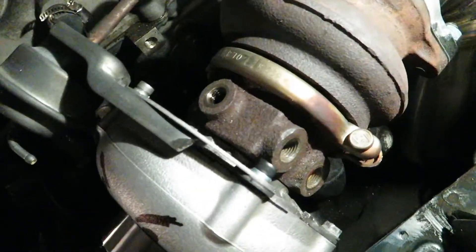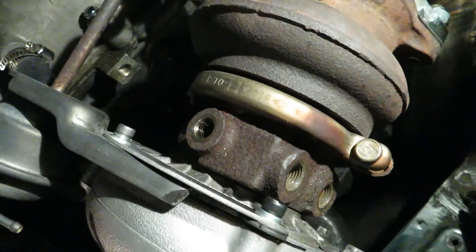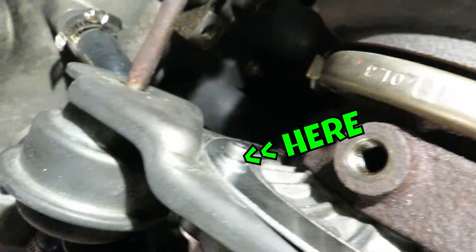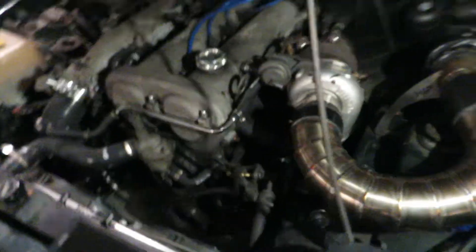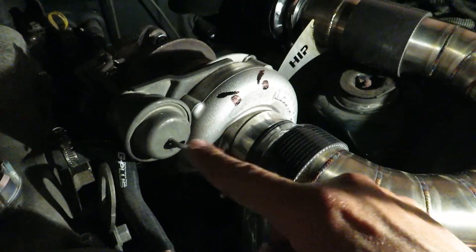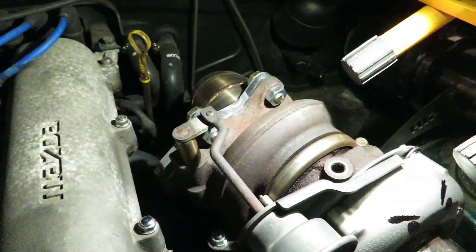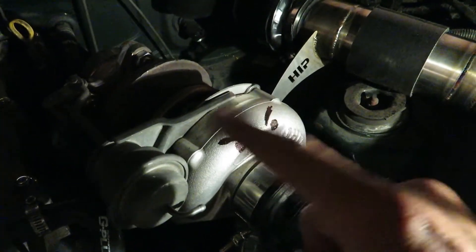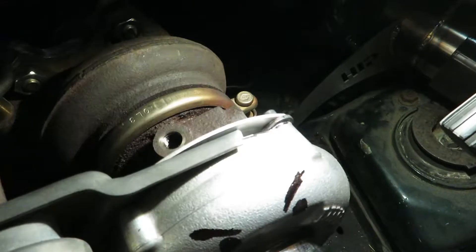Let's draw our attention to the bracket at the back — the wastegate. You can see that I chopped the end of the wastegate over there and then mounted a stainless bracket on the back, using that bolt there and another one at the bottom left. The reason why is because I had to clock the compressor housing, so the wastegate used to be out somewhere there. In order to put it in the right spot for the wastegate actuator arm, it needed to be turned around, so I found the holes on the compressor, drilled them out, and used that plate as a backing.